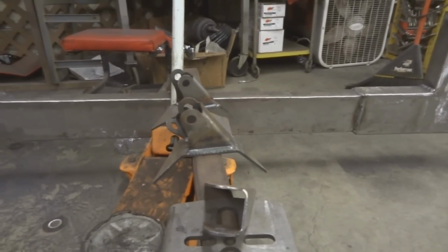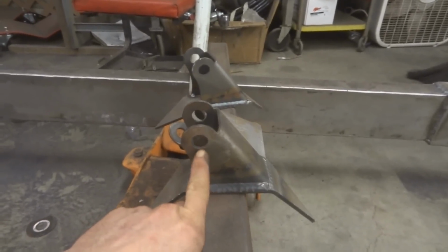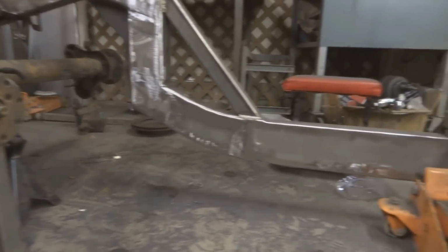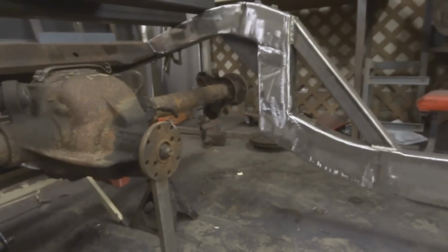So I ended up getting a calculation of the tail shaft of the transmission being about 16 inches off the ground, which is about level with this hole here. So what I'm doing is I took this rear end here, and if you can look kind of on a plane, I lined it up with that, approximately with that, right? So right now I have that drive shaft, so it's going to sit flat, and this is at ride height.